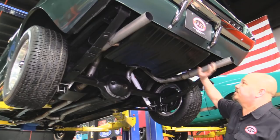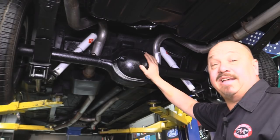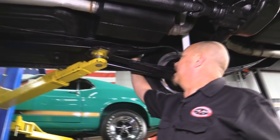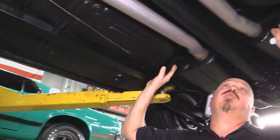We're underneath this Bullitt Mustang now and she is sharp underneath. You can see she's had a new gas tank put in, the exhaust system looks great, and the drop-downs look great. It looks like the brake lines were also replaced. We've got an eight-inch Ford rear end with a posi in it and it's right around 4.11 gears — the guys rolled it over to count it. Floorboards look great, frame looks great, and the inner wheelhouses are nice and solid. I always take a look at that pinch weld where the inner fender goes to the quarter. We've got frame ties on her.